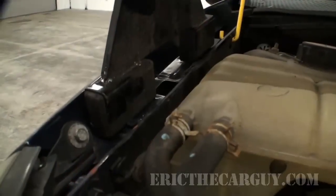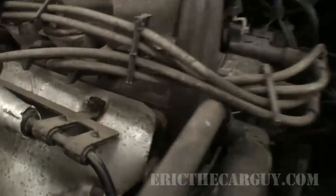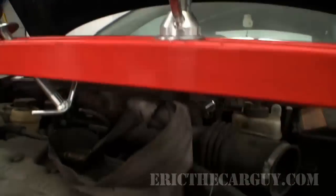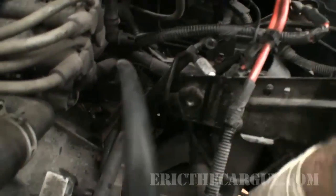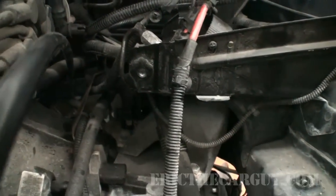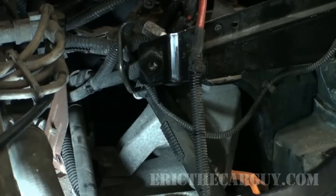All right, here's the setup. We'll run the fender on that side. We'll run the fender on this side. Wrapped around underneath here. Got it underneath the cylinder head, make sure it's wrapped all the way around and hooked up. Now I'm going to disconnect these two on the motor mount and, well, drop the transmission down and get this clutch out of here. Hope I don't have to tell you to stay out of the way and make sure nobody's underneath it when you knock this thing loose.